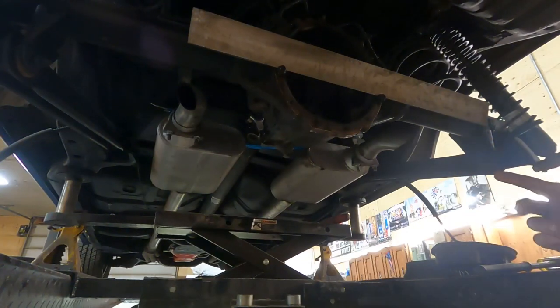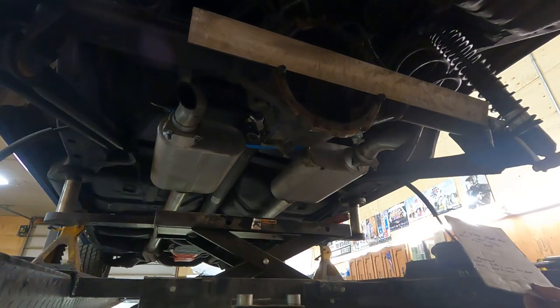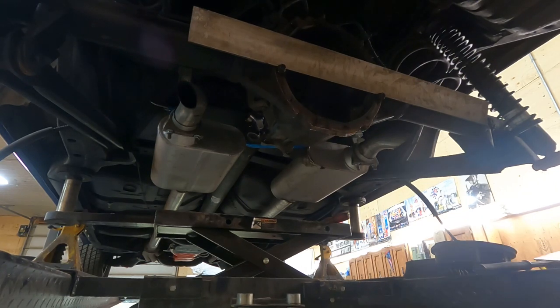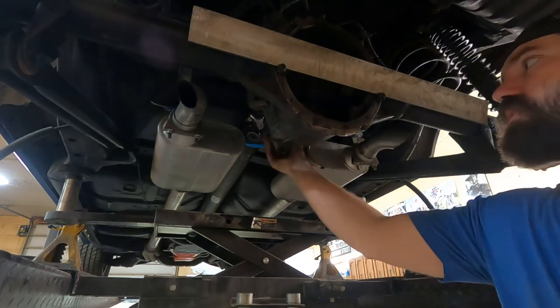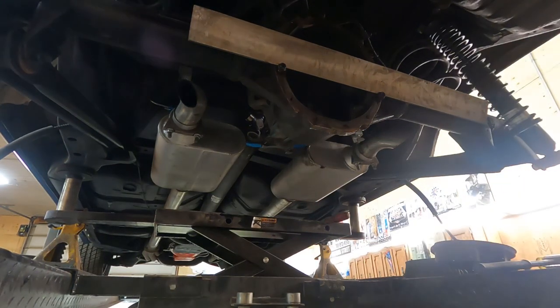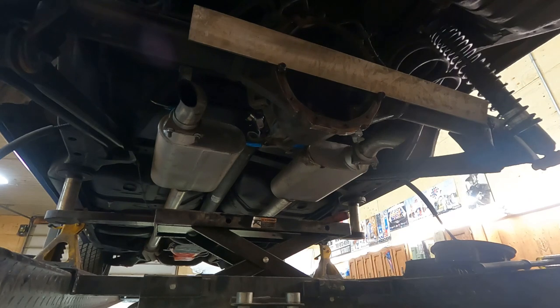So I got the pinion in, played around with the shims for the preload a little bit. So I've got a 15 thou, a 12 thou, and a 10 thou in there right now. And it's got some preload on it. Any thicker shims than that, it had play.